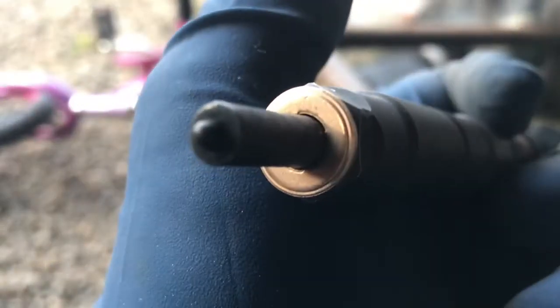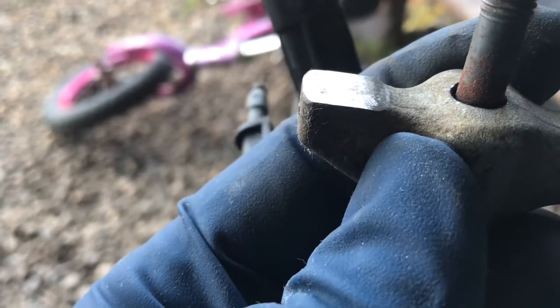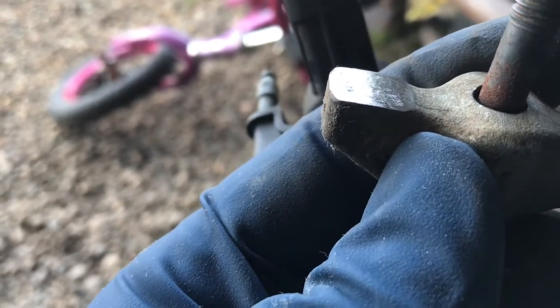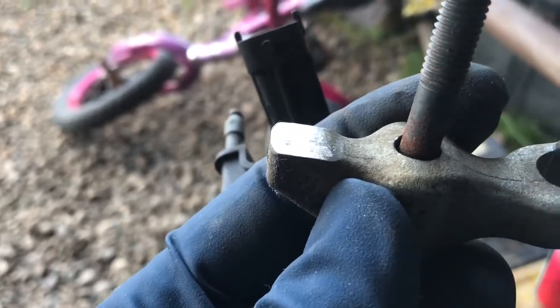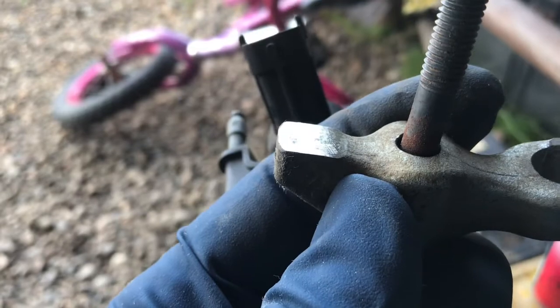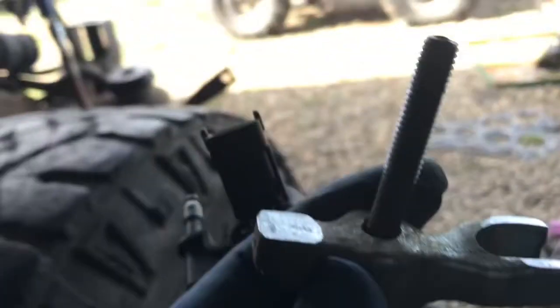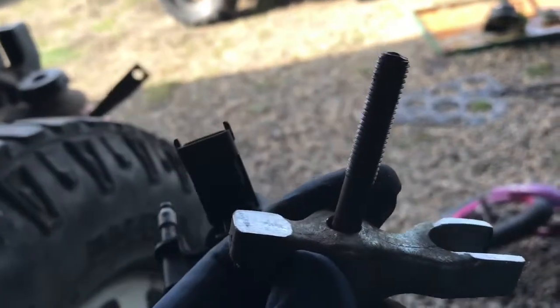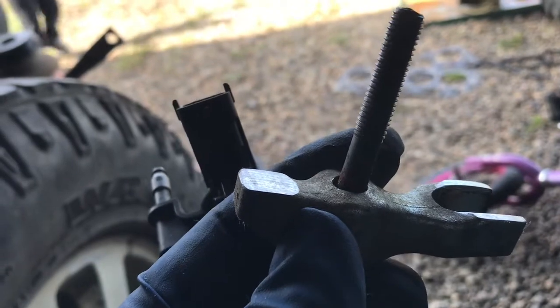What I do is clean that surface so that it makes the injector clean again. I clean this surface because the only place that was clean - the rest of it has rust except for the exact spot where it was wearing on that wear plate. I clean this all up because it's probably going to find a new mating surface now that I've got a layer of powder coat in there and that wear plate is sitting up a little bit higher.